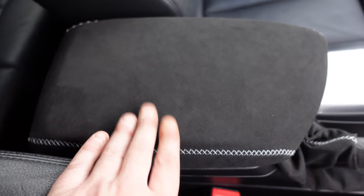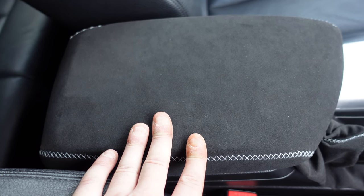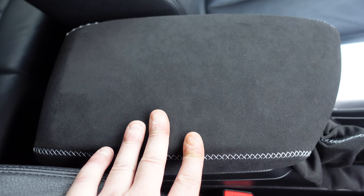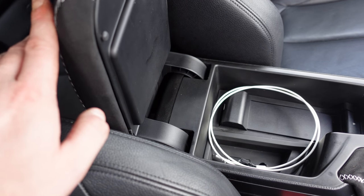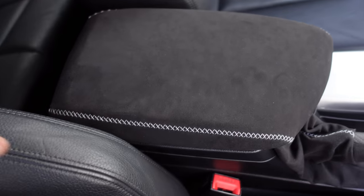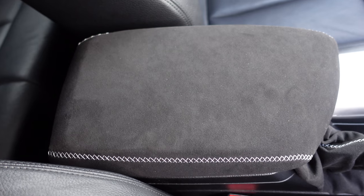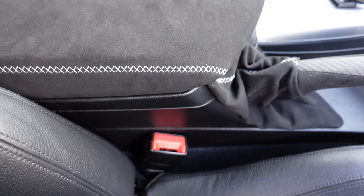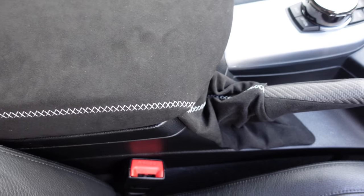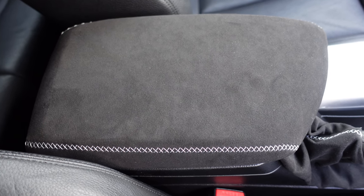When reinstalling your spring, do not follow people who tell you to push the spring down with pliers. The easiest way is, once you've got the spring aligned on the back, just lift up the armrest straight up and you can literally pop the spring in without the tension, to lock it in — it's very simple. That is the Alcantara armrest, and it looks really nice with the handbrake lever and goes in pattern with it completely. I'm really pleased with it. That is the Alcantara armrest install on my BMW F-Series.